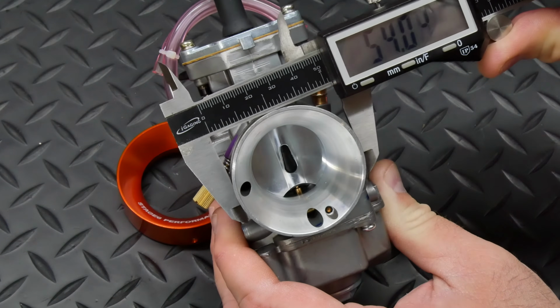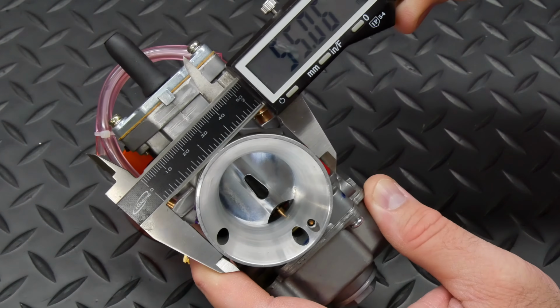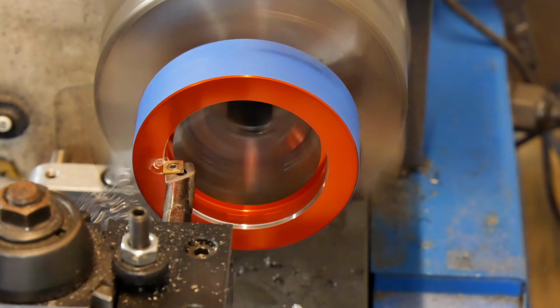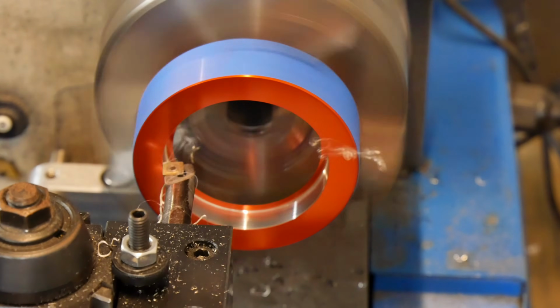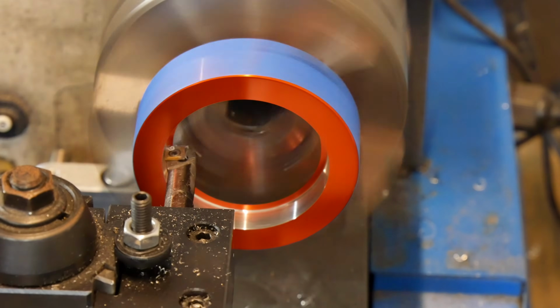just over 54 millimeters, but with a 55 millimeter lip on the edge. I removed the set screws, added a single layer of masking tape to protect the finish, and chucked the adapter in the mini lathe to cut the mounting diameter first.